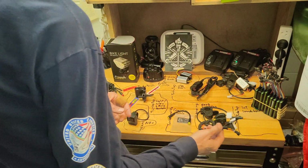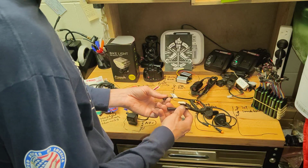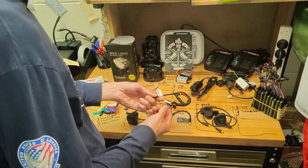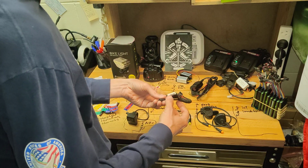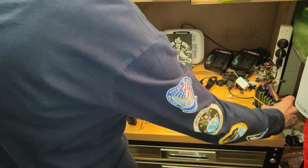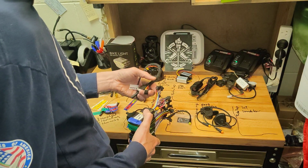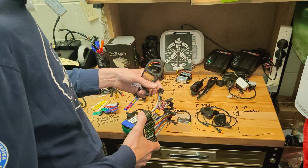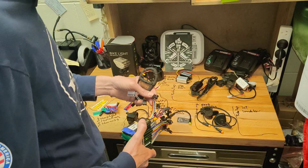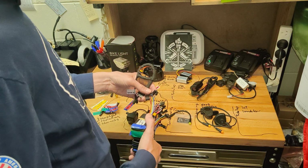The other thing we had too was, I now call it the TurboTap IoT immobilizer for NAMI. It resides inside the deck, plugs into your controller, taps into where the display throttle or the display harness connects, and off that it provides power for a GPS tracker. So that's your 72 volt on the red line for the power. Orange is accessories on, so when your scooter's turned on, the GPS tracker knows the scooter's turned on, because it does things when it's turned on, and it can show the status that someone's turned your scooter on.